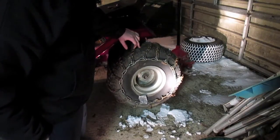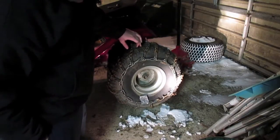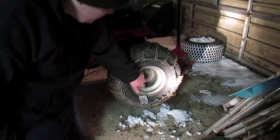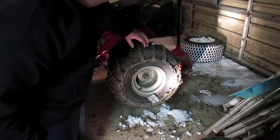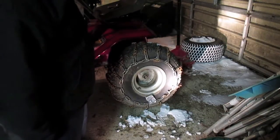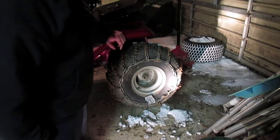That comes to Peerless. MST 205 is a little bit different than the original 5-speed. Because this one's like a 9/16 shaft or 5/8 shaft, and this one needs to be a 3/4 inch shaft. So that means that I can't put these wheels on this, so I can't have chains unless I can put these chains on those Toro wheels, but I really doubt that.